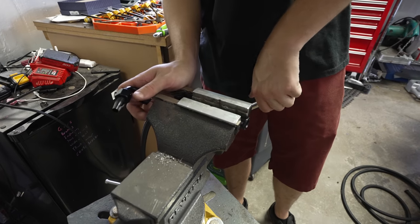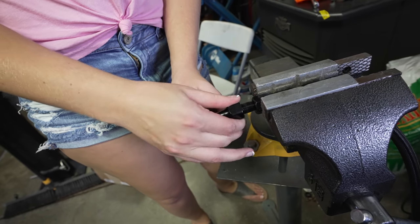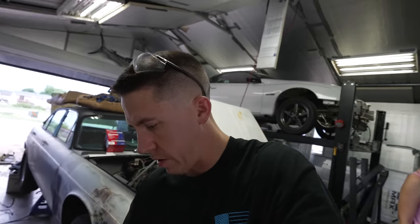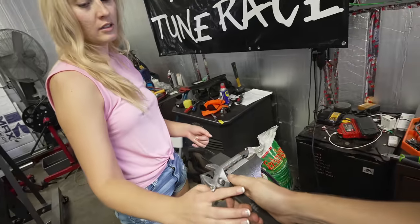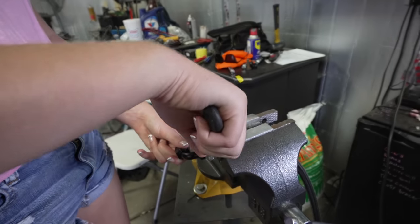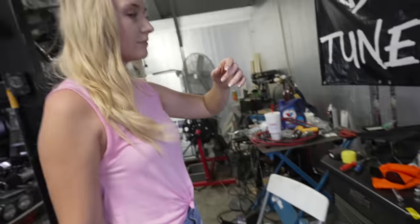Put it in the vise - it's always nice if you have some aluminum soft jaws so you don't mess up your nice high-dollar AN fittings. Take that and just try to work it in. You're going in a little crooked - there you go. Just keep working it in until it starts to thread. Now we need a wrench. I really need a set of AN wrenches - it's a set of tools I haven't bought yet that I really need to buy, so I got the adjustable AN wrench. Just keep tightening these two down until they butt up right there on the end and then you get a nice tight seal. I think you're about there - okay, that's tight.